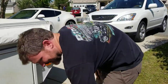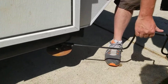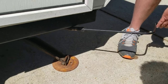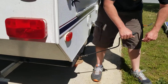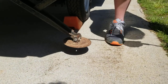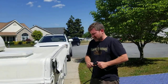Take your black crank — there will be four of these, one on each corner. Just plug it in; it'll have a little slot that it slides into and we'll just start to wheel it down. You don't want to crank this down too tight. Just get it until it's flat on the ground and gives a little bit of resistance. We're not trying to lift the camper up off the tires. This is so that when we pull the beds out on each side, the camper won't rock back and forth — it keeps it from seesawing side to side. Make sure you do all four corners.